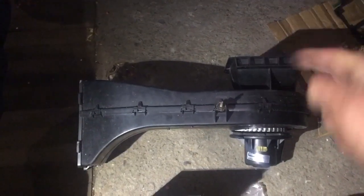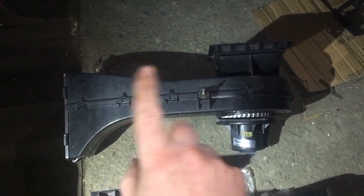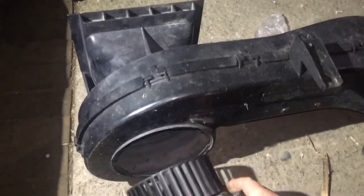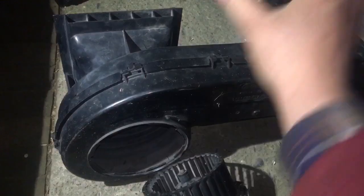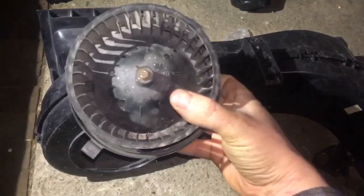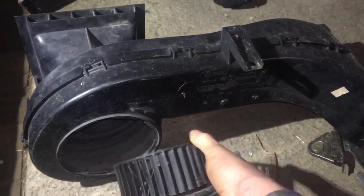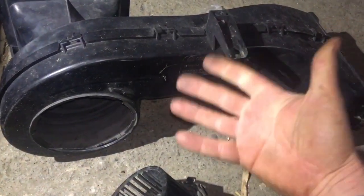Here we have the HVAC unit — fresh air comes in this way, goes through the fan, and gets pumped into your HVAC unit which sits over here. This was the left-hand drive version, which is the one I don't need — I need the mirror image of it. Thankfully I was able to buy one, and it's the mirror image, so everything is completely reversed. But the fan itself didn't work — it's totally jammed. However, I can swap the left-hand drive fan into the right-hand drive unit because the fans are interchangeable, which is brilliant. The issue is the fans in the car are prone to only working on position 4 while the other speeds don't work — I know it's a fuse that's blown internally.